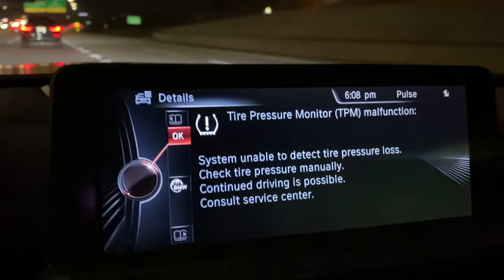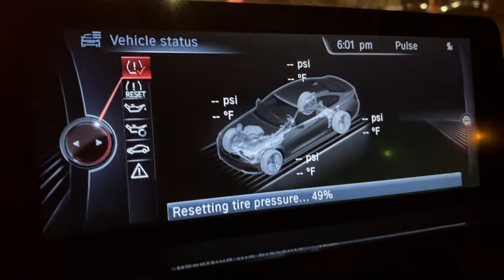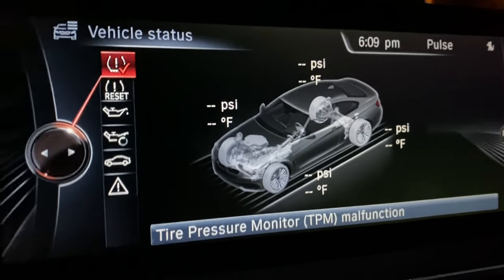This all started a couple days ago when I took off my normal summer wheels and put on my winter set. I bought these two seasons ago secondhand from a local guy, and they came with sensors in them already. I didn't know anything about the sensors — where they came from or how long they'd been there. When I mounted them last winter they worked fine, and when I took them off they were still working. But a couple days ago I went to put them back on and as soon as I started driving I got a TPMS failure error. I thought I just needed to reset them since it was looking for sensors in the old wheels. I went to reset it, but it would get all the way up to 49% finished, sit there for a long time, and then fail.